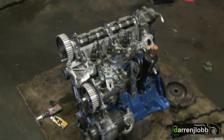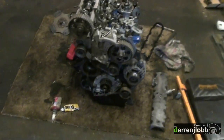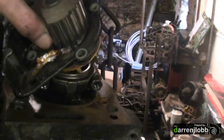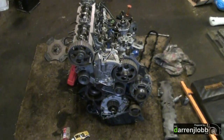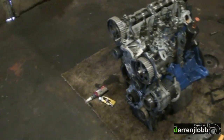As you can see, I've got most of the engine built up now, just basically bolting things to the block — pretty straightforward. Waiting on a few other parts. The water pump out of the old engine was going to be reused — like I said, this is a budget build, so where new parts aren't needed they aren't. But as you can see it's been weeping water out of the weep hole, so we definitely don't want to be reusing that. Tom is going to be bringing over another used one — I think it's the one he already stripped out of this block — so that'll go back in. Ideally there'd be a new water pump, but we're trying to save money so we're going to put that one in. I'm also waiting for a couple of dowels for the flywheel.